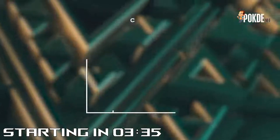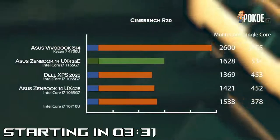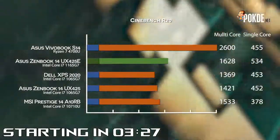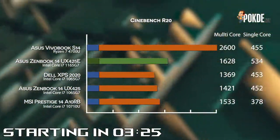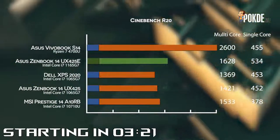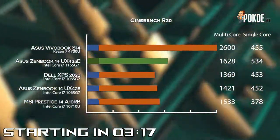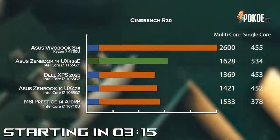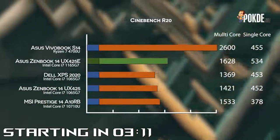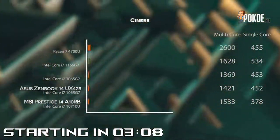Moving on, let's take a look at the CPU performance in Cinebench R20. The new CPU architecture in the Intel Core i7-1165G7 allows it to outperform most of the ultra-portables we have tested, including its predecessor in Cinebench R20. Tiger Lake does offer a nice performance boost, and most of it comes from the ability to clock higher than Ice Lake. The only area which we see it falter behind the competition is in the multi-threaded test, as it is nigh impossible to make up for double the cores, even if you increase IPC significantly.